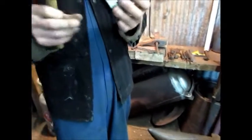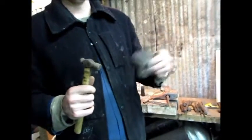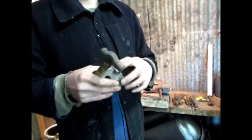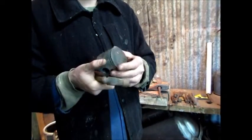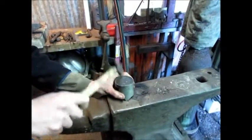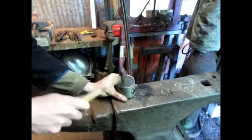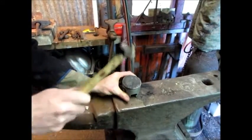So now what you've got is a slipper piston, which is less skirt and more revs for more speed. But also the ring grooves have got a little bit worn, so we want to close them up a little bit so the rings will be a bit tighter. So carefully tapping around here, you can close up the gaps.